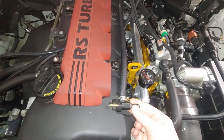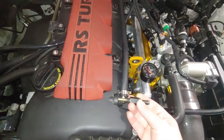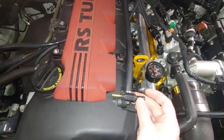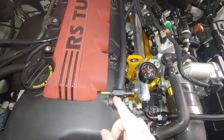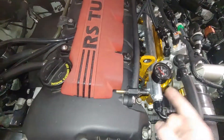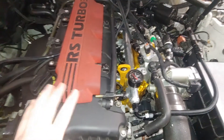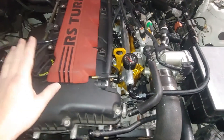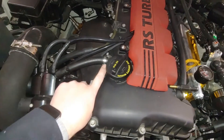This one on the second generation Genesis will have a different looking valve, but they still function in the same way. Basically, because this is connected to your intake manifold, that little ball, anytime it gets pressurized, it gets pushed back and it seals that up. Now if this ever gets clogged and doesn't fully seal, you're essentially creating a boost leak through here, and you're also going to be pressurizing through the head, which this is your only other vent. So basically, when you're at wide open throttle, or actually any level of boost — so you could have one PSI — and this ball closes. So your only vent under any load will be this side.